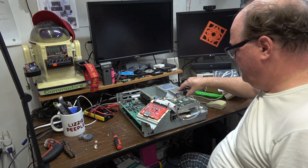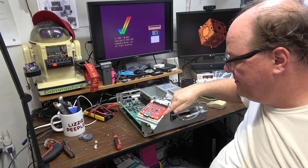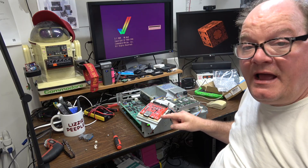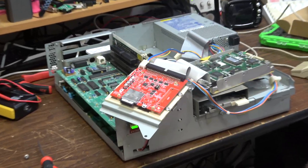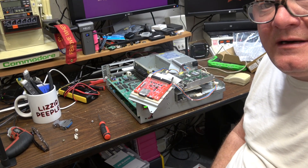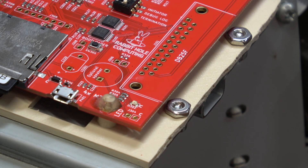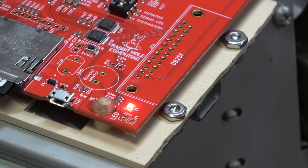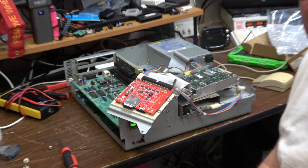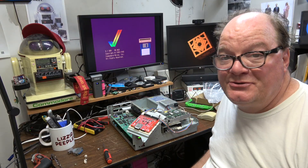Let me turn this off — it's going to blink. Hard drive's going to spin up. I'm hoping it doesn't crash, but it is literally dumping sector by sector, everything to this card — all 120 megabytes of it. As long as this drive holds up. That clicking noise minus the fan — uh-oh, hit a bad sector there. It's got a bad sector it's hitting, but it'll keep dumping. It's block level, so even if it's bad, you're copying it. You're going to have a bad image file, but you'll get your data off.